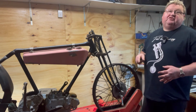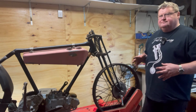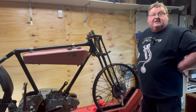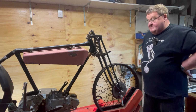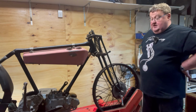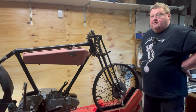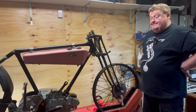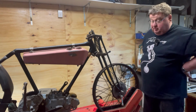If I can get this hub to work and the brakes work, it's possibly worth it, because I've got to get the wheels relaced anyway, because the spokes are damaged and bent and broken. It's possibly worth straightening or realigning the rim over the hub so that the rim sits in the middle. And it'd have to move about 1/2 inch. And that's not impossible.